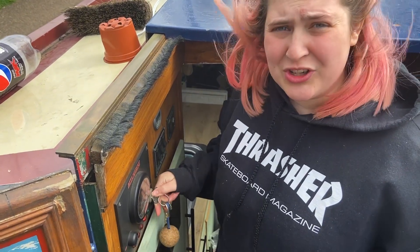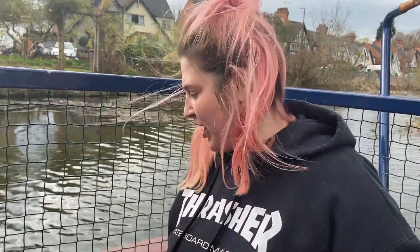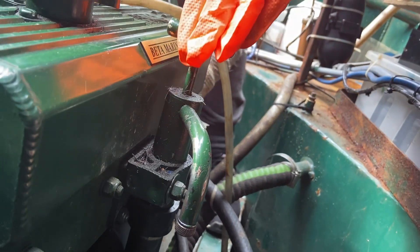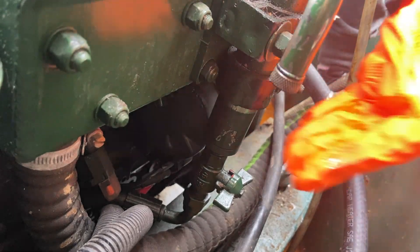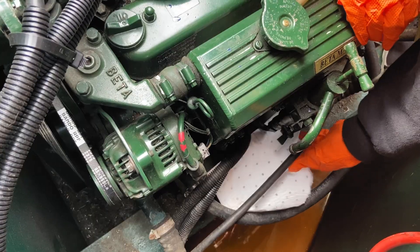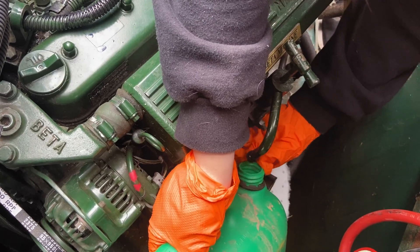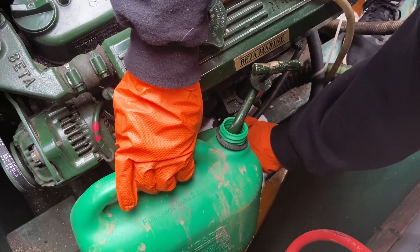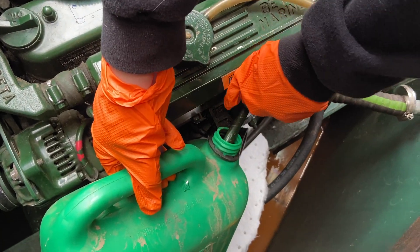Step one is to run your engine for about 20 minutes beforehand — it just warms up the oil and makes it so much easier to pump out. Now that the engine's warm, I've got my containers and the oil filter ready to go, and a pad to catch the oil underneath. So this is the sump pump which is what you pump the oil out with. This is just the cap to stop any leakages, and then there's a valve down here which you just turn 90 degrees and that lets the oil release out of the pump. Turn the valve 90 degrees and then just pump — you should be able to hear it coming out. Doing it slower and steadier is better, we hear.